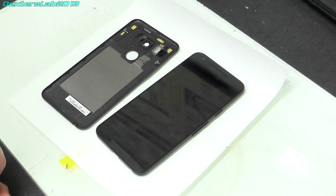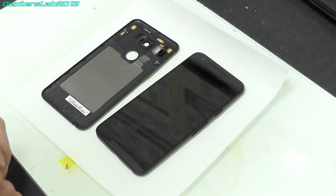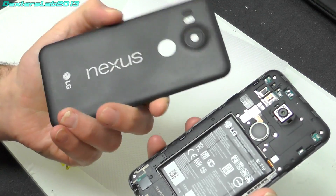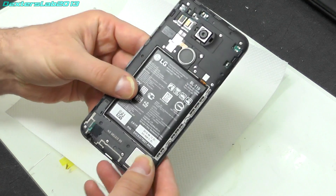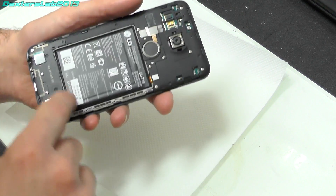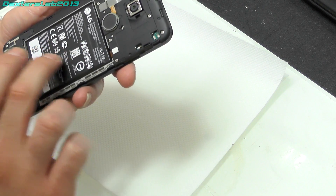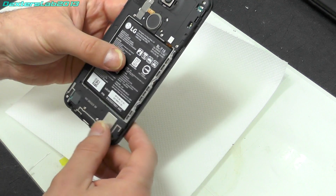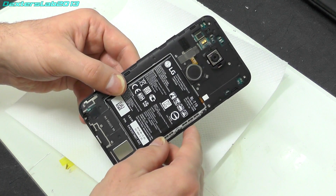I have to admit I've not done anything like this at all before, so it's all a new experience. I've got the cheapest, nastiest hot air rework gun known to humanity — it cost £20 delivered. So it'll be interesting to see how we get on. We just need to crack on, get the rest of this phone open, get the main board out and see how we get on. I've already taken the back off the phone. The next thing I need to do is extract the main board — there's a plastic cover carrier around this bit, and once that's off I can disconnect the battery connector and then look at re-flowing the RAM chip.